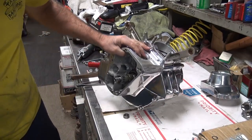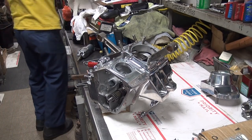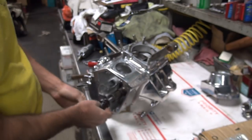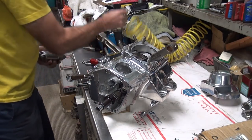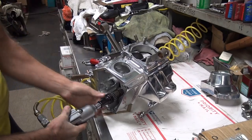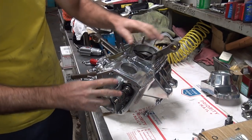Here's the nut. This takes a flat-style wrench — using a 3/4 wrench will round it off, so you need the proper tool. It's a left-handed thread, and you don't need lock-tight if you tighten it down. This will pull 130 foot-pounds, so don't hold on forever. After you put it on, rotate the motor and make sure the gear is not wobbling on the shaft. If it is, the key is sticking up too high. It all looks concentric — that's what you want to see.